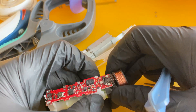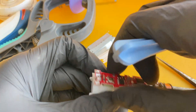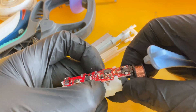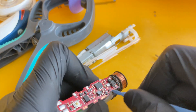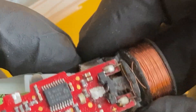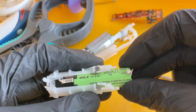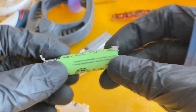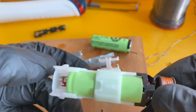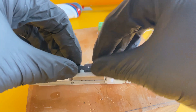This clip is quite tight so this is not the correct way. I found that I need to remove the notch at the front, remove the two clips in the middle, and then towards the coil area be careful because there are some very thin wires there. I'll remove the battery from the motherboard — this is the replacement battery I bought, same off-centered terminal. You may upgrade by using a rechargeable AA battery as seen in another video.